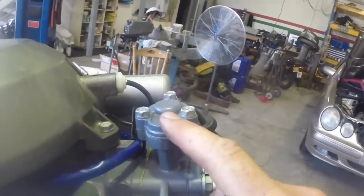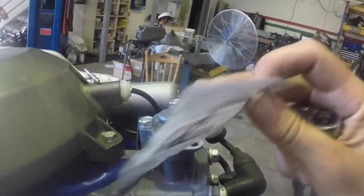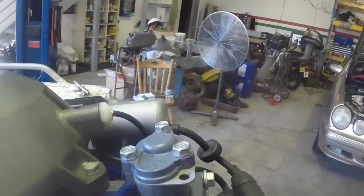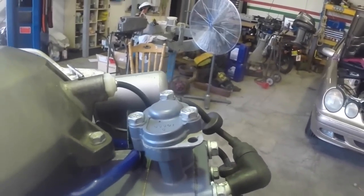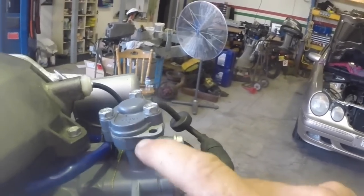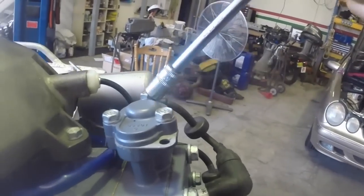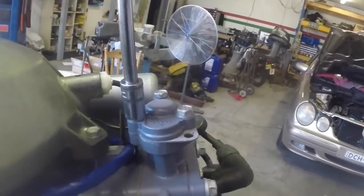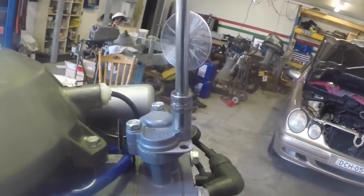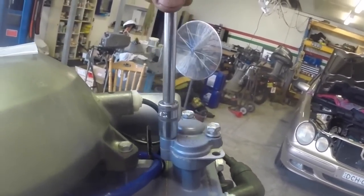So also just be aware, if you're going to check this, that you'll need whatever little gasket goes for your thermostat, because there's a really good chance that when you take this cover off, this thermostat will tear. And even if it doesn't, it needs to seal well, otherwise you'll leak water out here and you'll start shorting out HT leads or whatever. So this particular one just has 3 10mm nuts. So I'll just put this camera down, take these off, and then we'll test the thermostat.